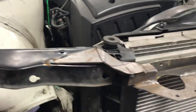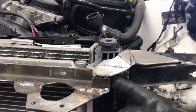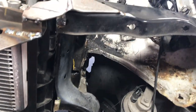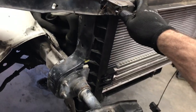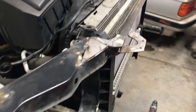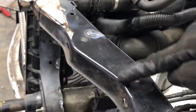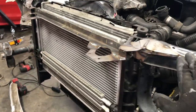Quick checkpoint here. I reused the existing frame rails and it is pretty strong. My focus now is to brace this up, connect this better, and then add some gusseting over here in between to prevent it from spinning. I'm gonna add gusseting on the back side so it's imperceptible, and probably some more gusseting inside here as well. Status: the radiator sub-assembly is basically completely installed. We do need to beef it up a little bit more, but it's actually moving because of weakness in the frame rails, which need to be gusseted next. Everything's basically tacked — nothing is fully welded except a couple of brackets. I did put additional gusseting underneath and within here. All this will end up getting sanded down, ground down, and painted.